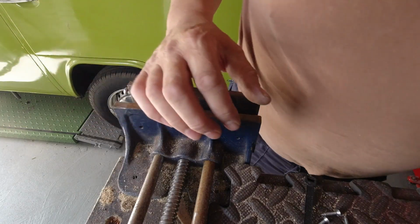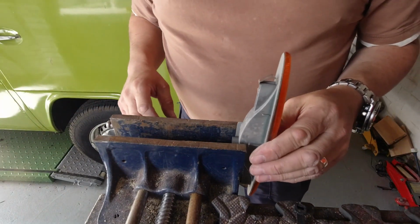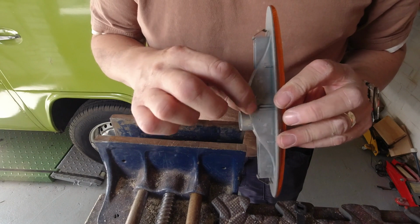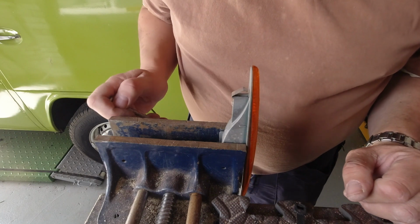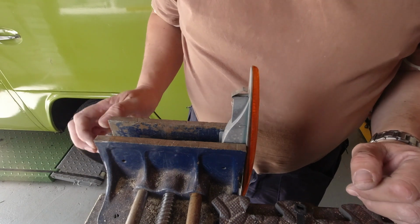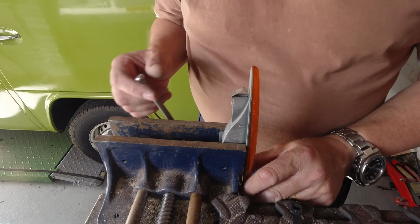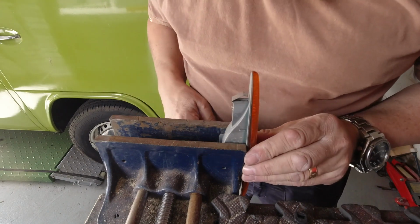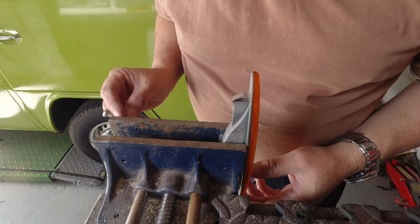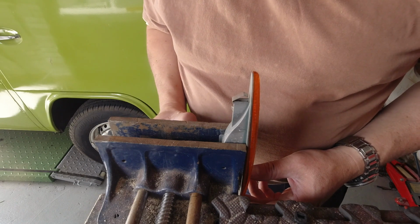As is always the way with these things, I think I've kind of perfected the technique as I'm on the last one. So this is what seems to be working best. There's a bit of a blade there in the side of my vise. I'm squeezing that. I'm squeezing until you hear a pop. Because you know where that's popped. It popped near that blade. And if you take it out at this stage, everything kind of springs back and nothing's happened. So you pop it back in and you go again. Squeeze it up till you hear a little bit of creaking noises.